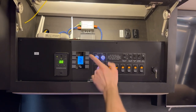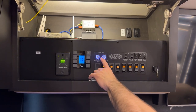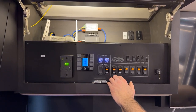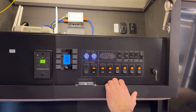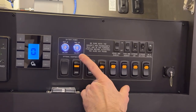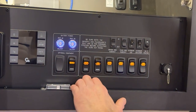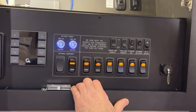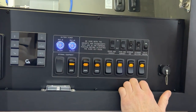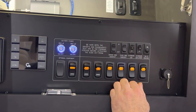You can select which awning you want to turn the lights on and then turn them on or off. These two buttons are the BMS on/off switches for your lithium-ion batteries. Right now they're both on. To disconnect power from your batteries, hold down the button until the lights go off; to turn them back on, press the buttons until the lights come back on. If your batteries turn off by themselves from losing all charge, make sure you have a power source ready to charge before turning them back on — otherwise they won't be able to reach full capacity.